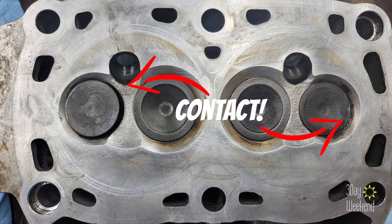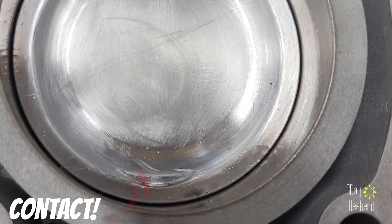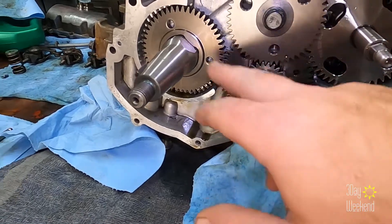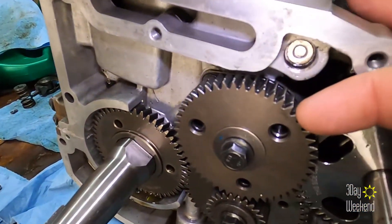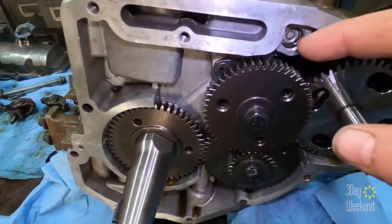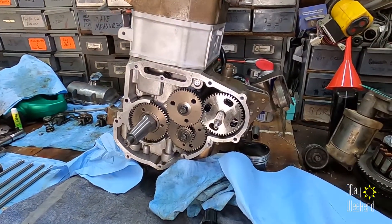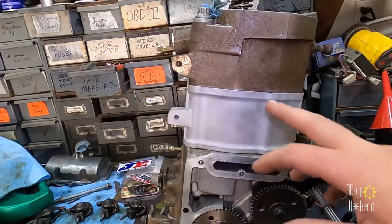So we're putting this engine together and just turning it over to prime the oil pump. And heard something hit, stopped, and found the bent push rod and the valve. We double-checked the timing right here and everything appeared to be in time — you can see there's little timing marks and everything was lined up. But upon further inspection, this outer part of the cam gear — you see how it's split? That separates and it's held in place by springs. It was misaligned with the inner gear. There's a timing mark on the front and there's a timing mark right behind it on the main gear, and those weren't aligned. So if you don't line those up, your timing is 120 degrees out and your valves can touch pistons.